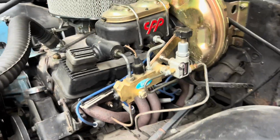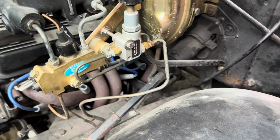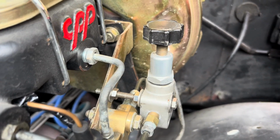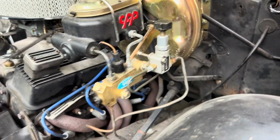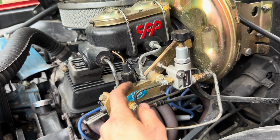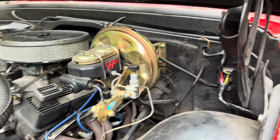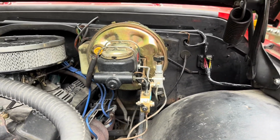Okay, so I'm pretty happy with it. It's part of the truck now. It's sturdy. And all that is a 10mm bolt with a fender washer, nut, fender washer, then a nut. Holds it nice and good on there. These lines, I can clean them up a little bit. I will eventually, but we're doing this. That's just a lot better than it was. This section of the truck already looks a lot better. Just so that being held up straight is nice.